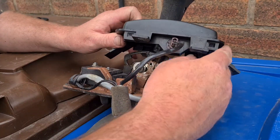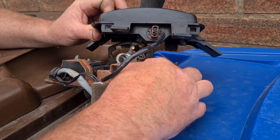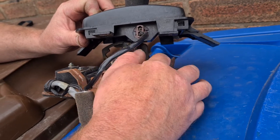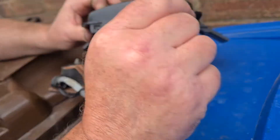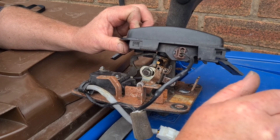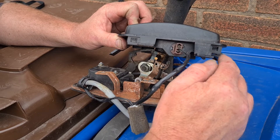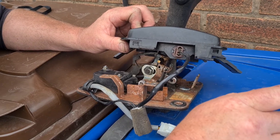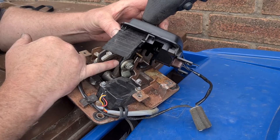The other problem is that bracket has a cable connected to it, and when you go into park it pushes the cable on the ignition barrel, which then lets you take out the key. You haven't adjusted this correctly or it's not connected properly for it to push the pin at the ignition barrel to be able to take your key out.